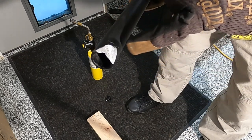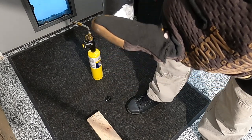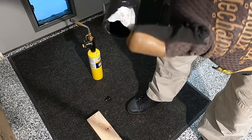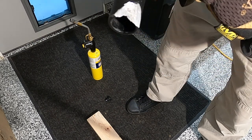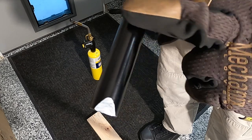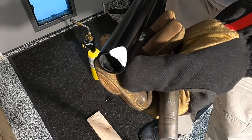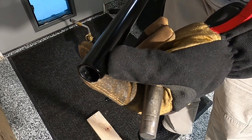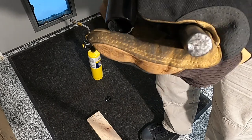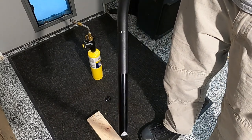This tip is just sticking up a little bit — I want to make it all flush, so I'm going to grind the side real quick. Then I'll spray some alcohol, lightly clean this up, mask it off, and paint it. Same thing with the other side — this is the smooth side where the throttle's actually moving, so you don't want to get any paint on it and make it rough. This side is looking good and pretty flush, so I just need to work on this side and get this bad boy ready to assemble the handlebars.